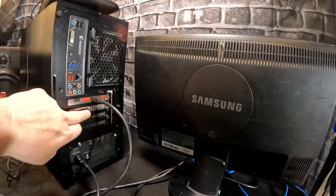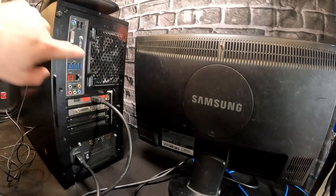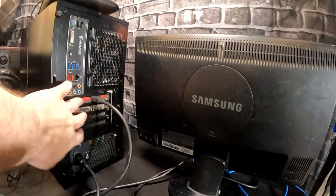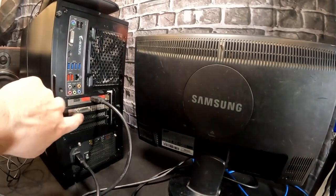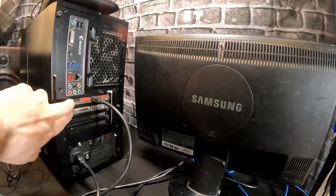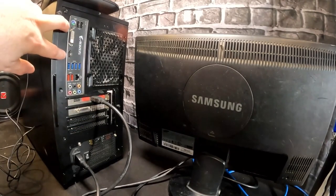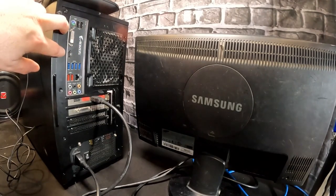A dual link cable is the one like what I showed you on that web page. Dual link is better than single link, and this is just the built-in video card as opposed to the one I added in. Speaking of which, this is important for everybody to know. You'll notice I've got these connectors here, and then I've got this connector here along with another HDMI here. This is a video card which outputs video, but this is actually also a video card built into the motherboard, and that outputs video too, depending on which conditions are met.